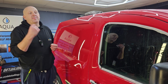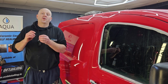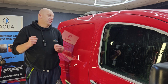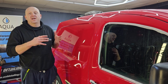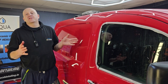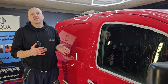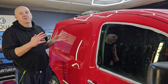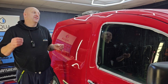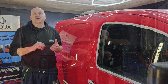However, in terms of preparation, the process is the very same as in the case of paint correction, so you do all the decontamination stages. Also, I use panel wipe to make sure I'm not leaving some sort of bad finish, haze, holograms or buffer trails. And of course, the time I'm spending on the vehicle, in this case, is a quick action. I think for the results I'm achieving within the time I spent already, I'm getting really good results. If this was paint correction, I would have to spend 3-4 times longer.